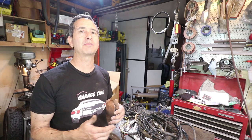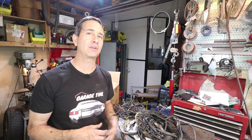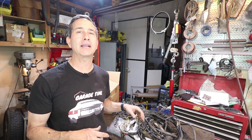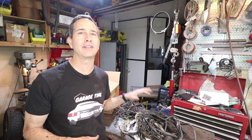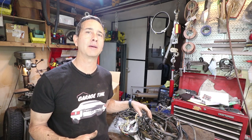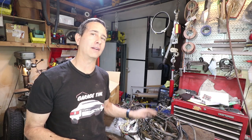You just don't have as much room for error — there's not as much buffer, so you have to maintain it really well. That's the negative side. The plus side is this is a lot easier than the 911. There's a lot less circuits, the wiring diagram is more simple, and nothing is going to be custom on the wire harness.